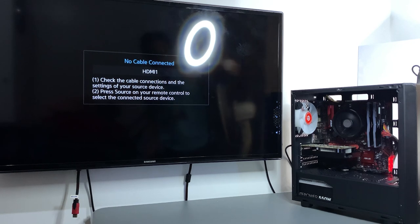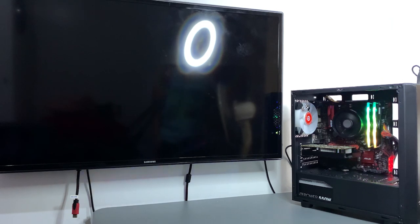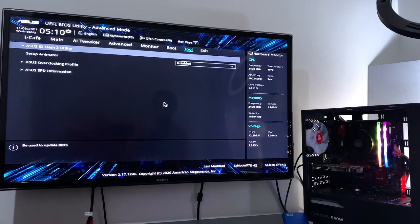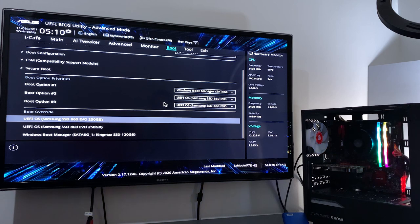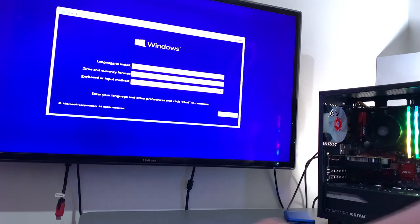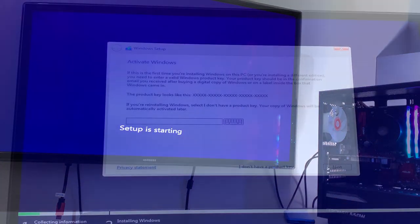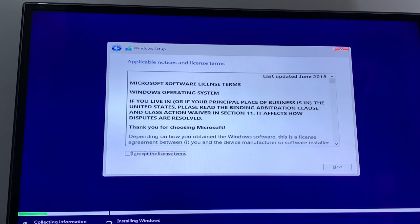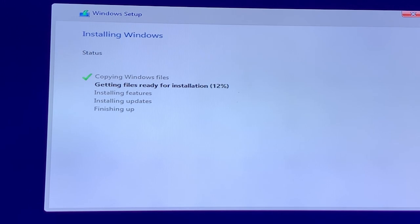Alright, this is it. Pressing the delete key to enter the BIOS and it boots. Now let's plug in our Windows install media and boot off of that — I have an external SSD for that. Load into the installation media. Select 'I don't have a product key' or enter your product key, check the box and click next. Select Custom, then select the drive where you want your OS to be installed on, and wait for the installation to finish.